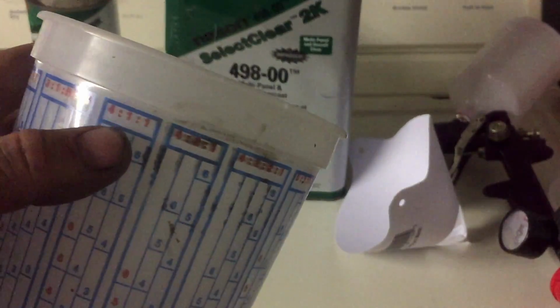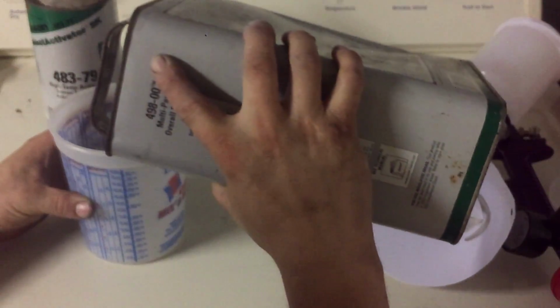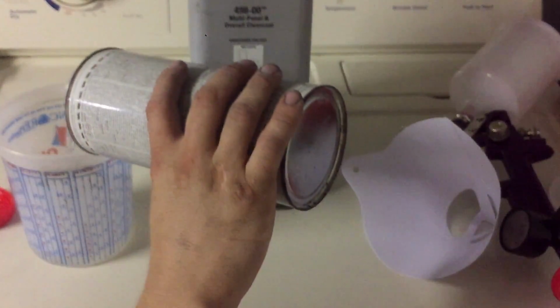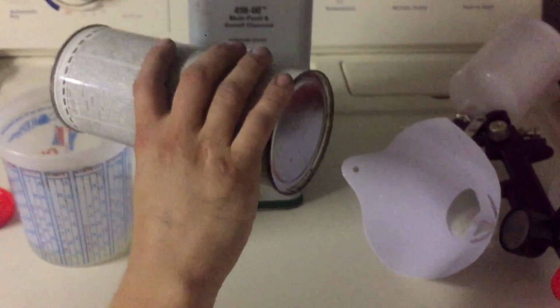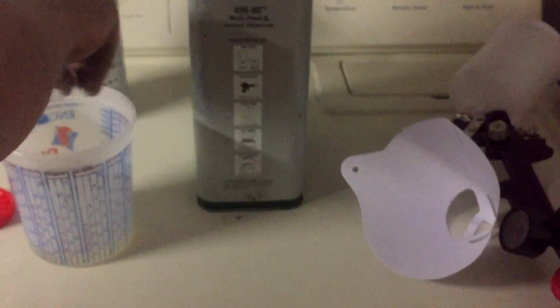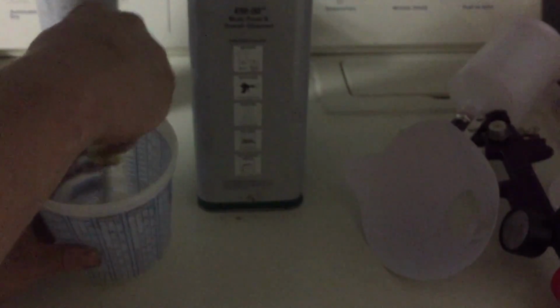Alright, so I'll be mixing up 2 ounces, so I'll find the 4 to 1 to 1 ratio, which I'll only be going 4 to 1, just the clear and then the reducer. So I will fill this up with the 2K Clear and then mix in the reducer. I'm also going to be adding some Pearl Flake to it that was sent in by a subscriber to my P.O. box. Mix it up very thoroughly.